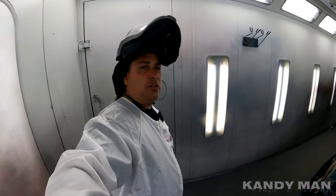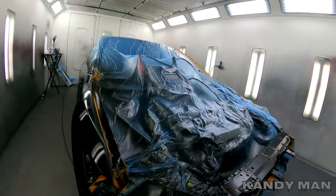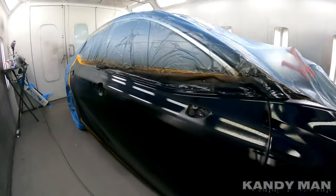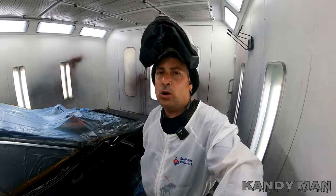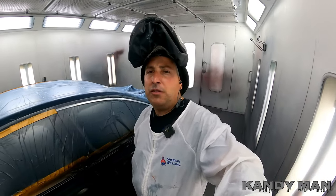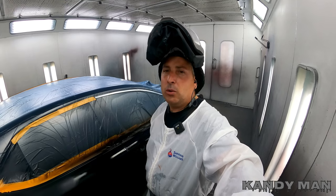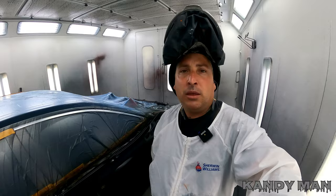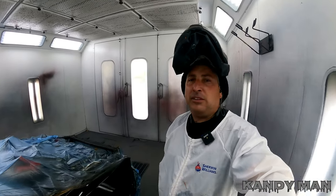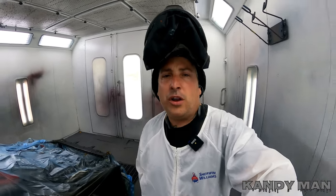I think it'll be really nice to see a real candy on that car — it should really pop with all those cool body lines and round body panels. I'm really looking forward to shooting that car with the DV1. I'm going to use the DV1 base gun for the base and then the DV1 clear for the candy and the actual clear coat, because that UK candy is the same consistency as a regular clear coat — it's hardened and everything — so you've got to get that stuff to break up and I think the DV1 will do it really good. I'm going to use the C1 on it.